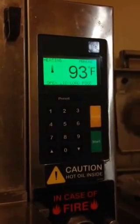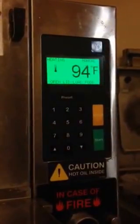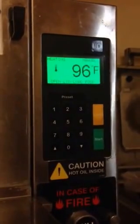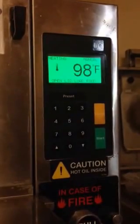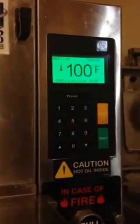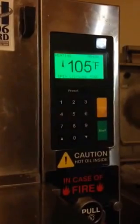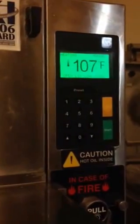This is a Perfect Fry model PF720. This should work with any Perfect Fry unit that has a main fan problem in it. You want to spin the fan with the air pressure until you can hear it spinning quite rapidly. If there's a bad spot in the motor, it tends to get it off the bad spot. Also, the velocity that you spin it at tends to clean the fan blades off so that they work a little better.